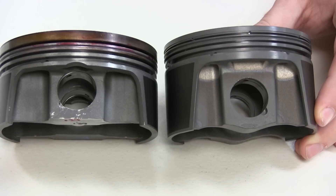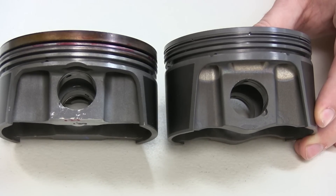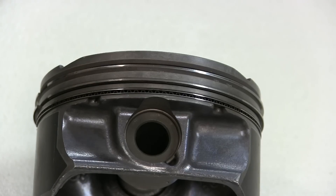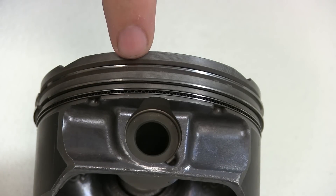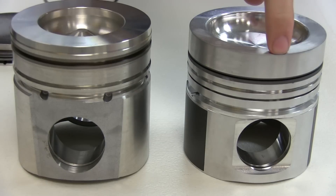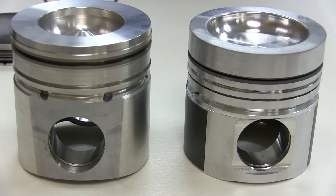How does the chance of ring groove microwelding affect aftermarket piston design? Ultimately, running the top compression ring as high as possible on the piston will result in improved power, economy, and emissions. This has been proven on the OE level and in restricted class racing. However, with the rings as high as possible on the piston, the chances of microwelding are higher — note the ring groove coatings on this OE piston. In some cases, it is not possible to run the ring high because the piston and rings are subjected to much higher cylinder temperatures and pressures than originally designed, particularly with power adders. In these cases, the ring grooves are moved down in the piston to protect them from the extreme conditions, as you can see on this OE versus forged aftermarket diesel piston comparison.